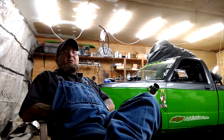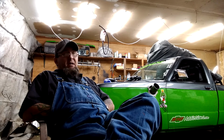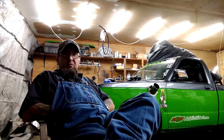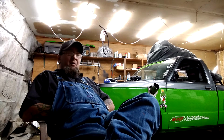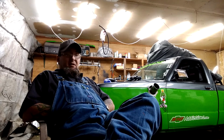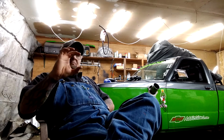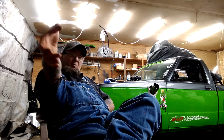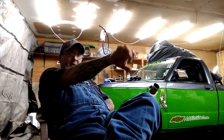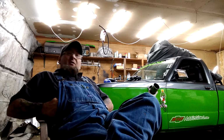And speaking of boost, the turbos are 2 VS Racing 78-75 1.25 AR Gen 2 or next gen turbos. 2 44mm wastegates on the CX Racing turbo to header adapters and 90-degree adapters, with the setup for the wastegate where when it turns, the wastegate is in line with the exhaust flow, not coming out the top or the back, but right in the middle of the bend where it is in line with the exhaust flow. I thought those were a better option.